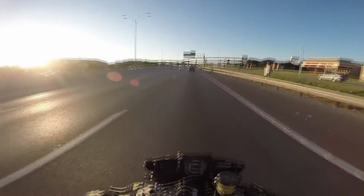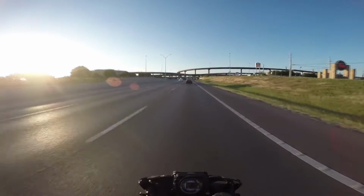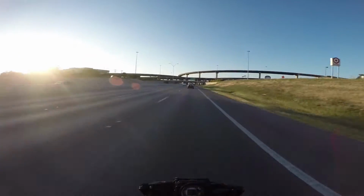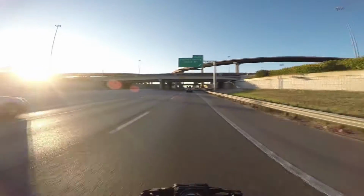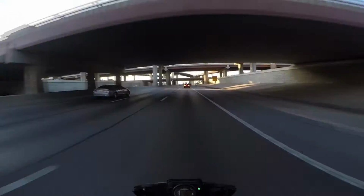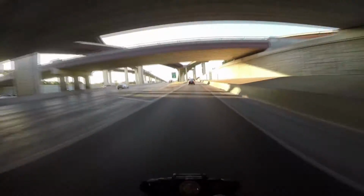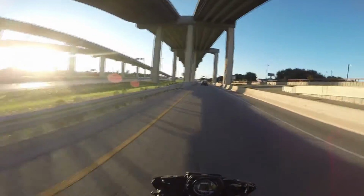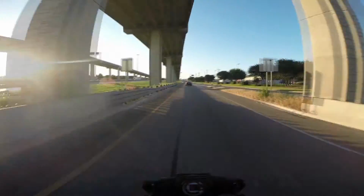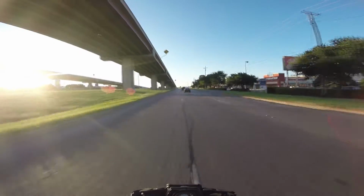The other thing is this bike has incredible cooling. Either this bike has an incredible cooling system, or the thermostat doesn't read very accurately. It's one or the other, because in the garage with the fan on, this thing won't get over 185, 190. Even the fan doesn't kick on with just my box fan on, which is really pretty phenomenal, because the Hondas and stuff will easily get into the low 200s. So it's a very big, very effective radiator and cooling system in general, I guess.